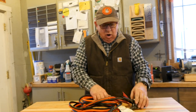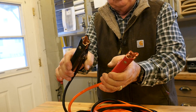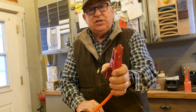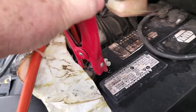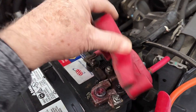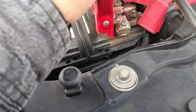Stretch out your cables and make sure the ends are not touching each other. Begin with the recipient or the dead vehicle. Here is a memory cue that is really easy to remember: red to dead. Red means hot or positive; black means negative or ground. This is where power flows into the system; this is where it returns to complete the circuit. So the first clip: red to the positive terminal on the dead battery. Get that on there very well — wiggle it around, it may come loose — reset it until it's really firmly clipped. Number two: go to the donor vehicle and attach the red to the positive on the donor vehicle. Nothing done with the black yet. Red to dead, then red on the live battery on the donor vehicle.